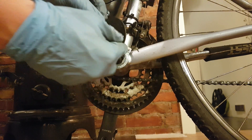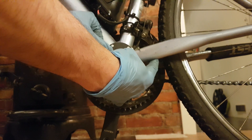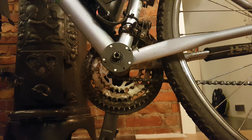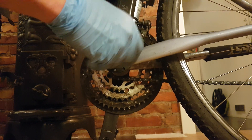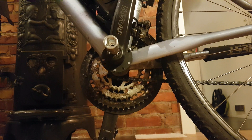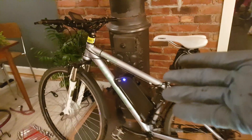I've made a little mistake — I placed this magnetic plate on the wrong side. It has to be with the magnets facing outside. Otherwise you have to pedal backwards in order to get pedal assist forward, which is kind of silly. My mistake, but luckily it's easy to fix — no big deal. Alright, so everything is done!